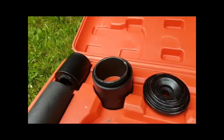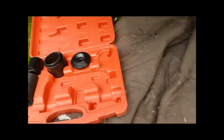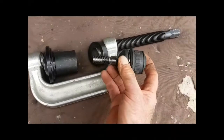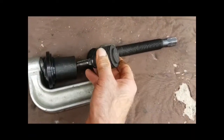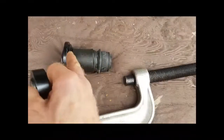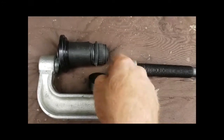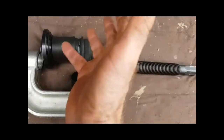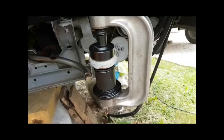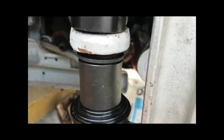It's one of these cheap kits, and as you can see some of the parts have been bent from the pressure of previous uses. There's the kit - this is the best setup I've found. That's going to go down below like that, and the top will obviously be in the suspension arm. I'll slide them over like that. That's pushed in, that goes underneath, and that pushes from the top down - then you tighten it all up pressing it down. That's a 22mm socket on top - that's how I've got it set up.